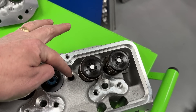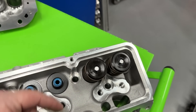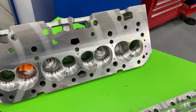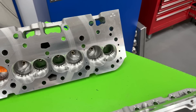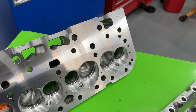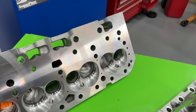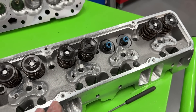In some cases you also have to slot the hole itself because the tilt means the bolt or stud won't go through. Point being, it's a considerable amount of work. So I actually don't ever angle mill — I have it done from the factory. Like this one here is angle milled; that's how they got to 55cc's. The factory does it before putting in the seats, so the rocker arm geometry is correct afterward, which is way better than milling after everything is already installed.